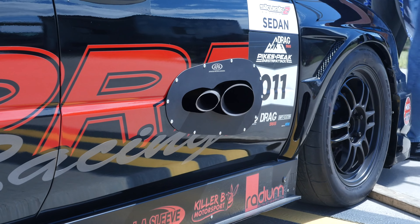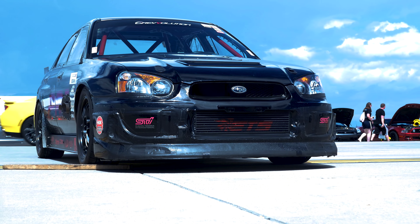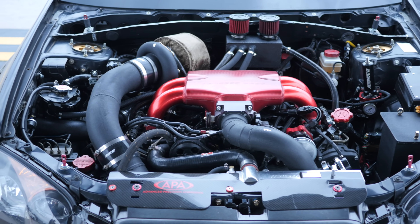The car makes close to 1000 wheel horsepower and has gone close to 200 miles an hour. The fuel being run is 98% ethanol from Thunderbolt Racing. The turbocharger is a Precision 7675, their newest Gen 2 Aerodynamics — a fairly large turbo fitted specifically for this race event, as the previous smaller turbo couldn't achieve the desired boost at elevation. The target boost pressure is around 52 to 53 pounds. On the first pass they hit about 45, so they're working to get back to target to hit close to 200 miles an hour.